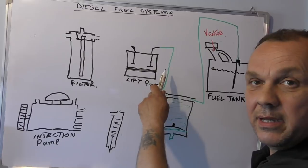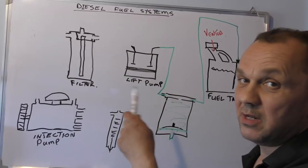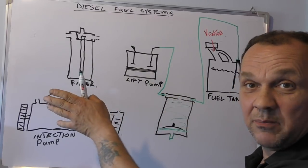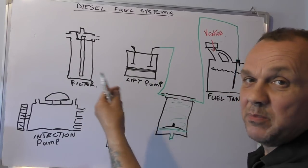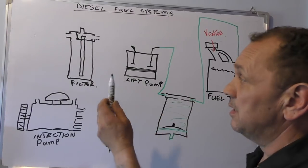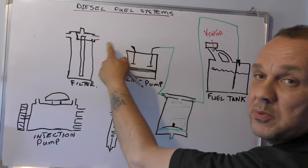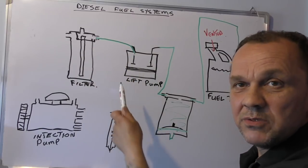We'll go to the inlet of the lift pump. I'll warn you that with older diesels some don't have a lift pump — they have a transfer pump in the injection pump and they rely on a complete vacuum in this system, so if there's any leaks you get problems up the other end. This one pulls diesel with the lift pump, so even if you have a slight leak you'll get away with it for a certain amount of time. The lift pump has a valve: when it sucks in it opens the valve; when it pushes, it closes that valve and opens the outlet.